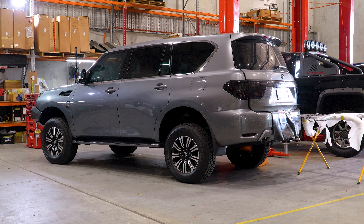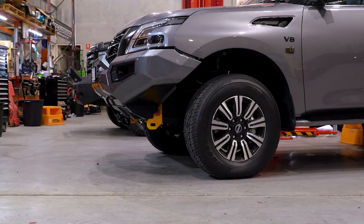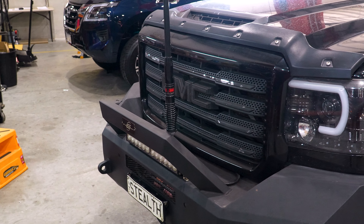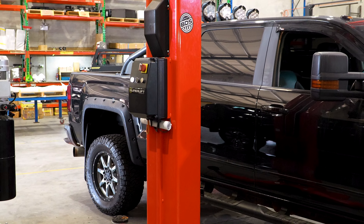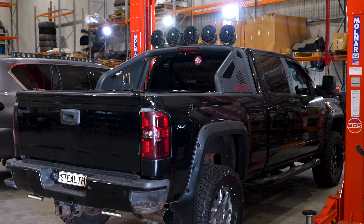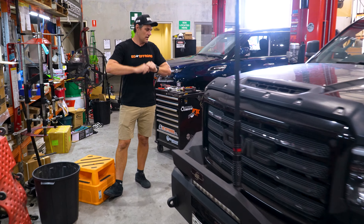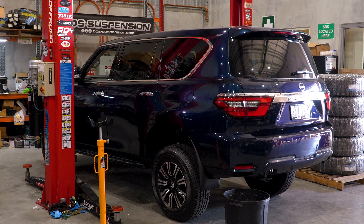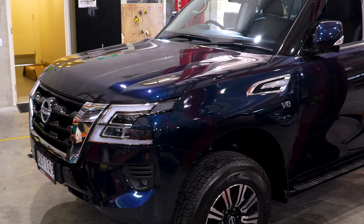Over here, another Y62 Patrol GVM. We've got the dash bar, roof rack, compressor in the back — pretty standard essentials pack, chrome delete, looking awesome. Over here on the hoist, we've got an older GMC 2500, still got the Duramax. This one's had a hard life — been sent down from Darwin. We've pretty much replaced everything underneath: pitman arms, sway bar links, tie rod and steering rack, rear bushes, shocks, Outback Armour shocks, upper control arms. A bit of a refresh after its hard life in Darwin. Over here we've got the Y62 Patrol in for the big 4.5 ton GVM by the boys at DMW.